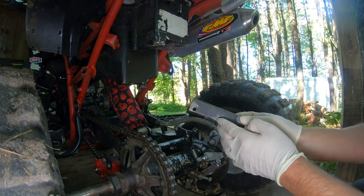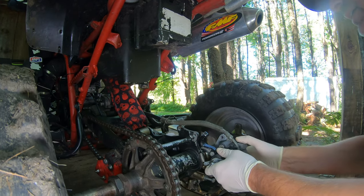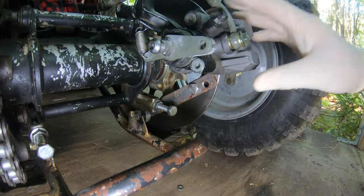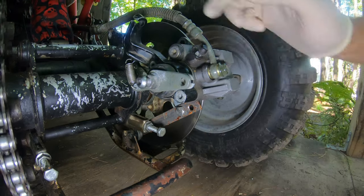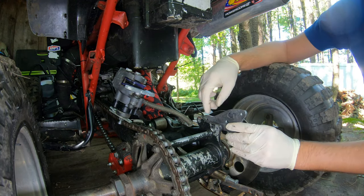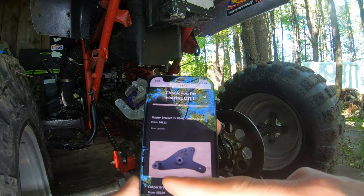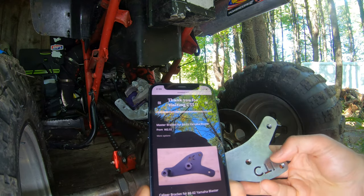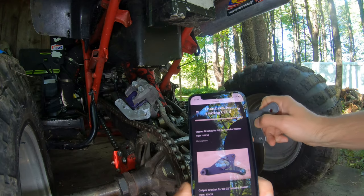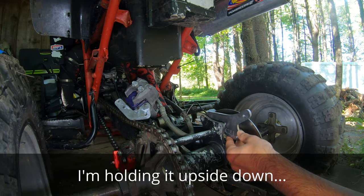There's the piece I fabricated out of inch-and-a-quarter stock, sitting on the original carrier. Down below I've got a nut to take off — I used this to keep the caliper from rotating. Let's get this all cleared out so we can try the Crone Tech solution. Almost, but not quite — I can't mount on the outside of the carrier because of this bolt coming through. Here's a photo on the website showing the spacers, which makes me think the idea is to get over this component, put the spacers on, and clear that gap.